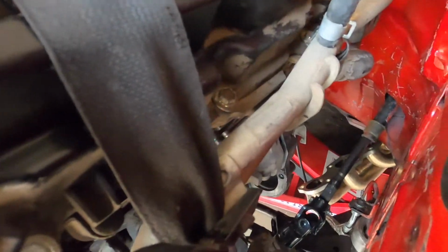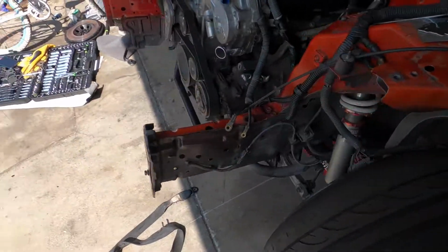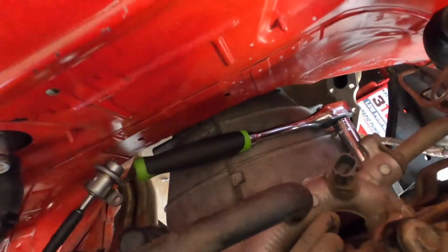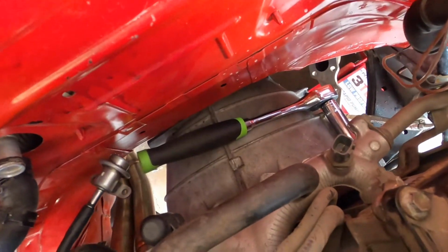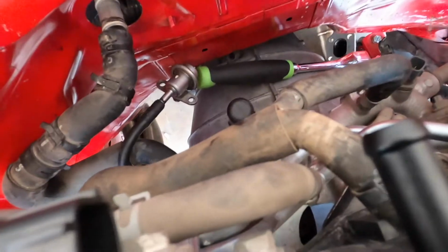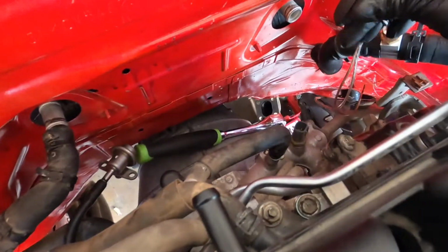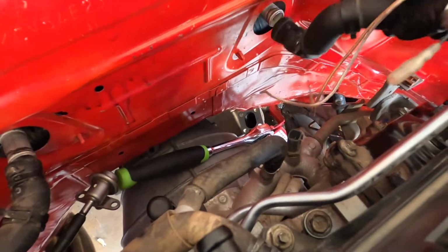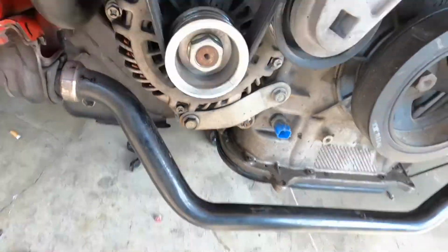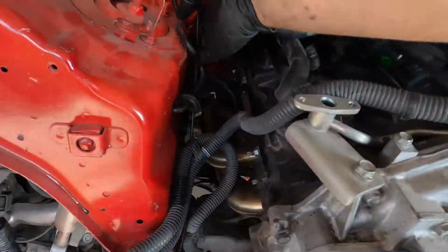We just gotta go down to the bottom and lower the trans out a little. Oh, never mind. We lifted the trans a little bit and we got it to line up. So I'm just tying down the bell housing right now. I'm gonna put my heater core hoses on, wire my coolant temp sensor, throw this on right here. I'm gonna do the oil change, the oil sensor, and throw my oil sandwich plate on so I can run my oil pressure gauge, which is right here.